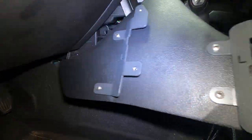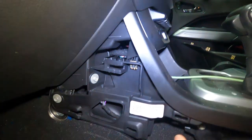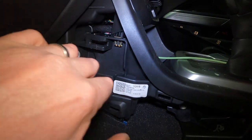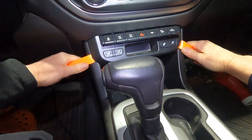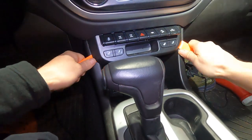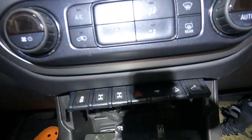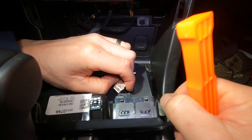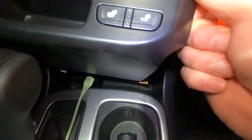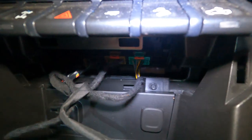Remove the two side panels of the console — this was pretty easy. There are attachment points where you just get underneath and pull with your hand and it should pop out pretty easily. Up next is a real problem: getting the switch panel out with all your stuff for four-wheel drive rockers, etc. You have to come in from the sides and slowly pop it off — this took me a long time. Be patient. Once it's out you'll have little power cords underneath that you need to disconnect; I took photos so I could remember what things looked like.